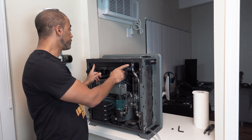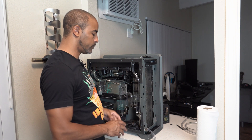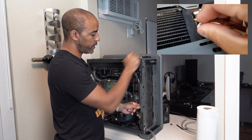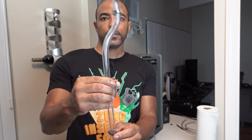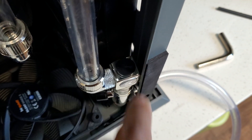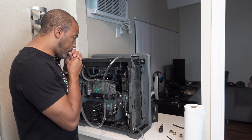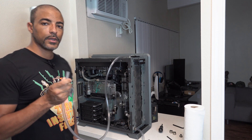Because the whole point of draining is to install the water block, I need easy access to the CPU, so I actually have to take out the top radiator. Due to air pressure, as much fluid as possible will naturally drain into the bucket. Then I have to start disassembling some of the hard line tubing and attach a soft tube to a section of the radiator to force air through the system and push the rest of the fluid into the bucket.